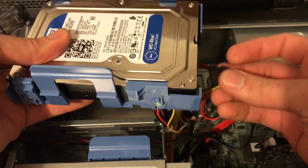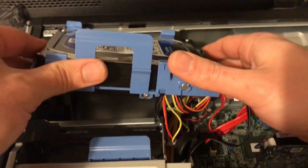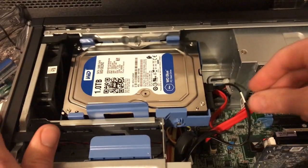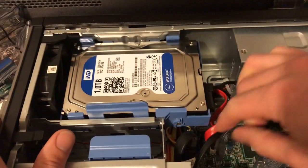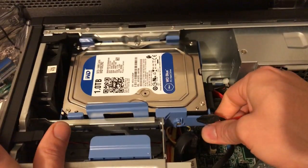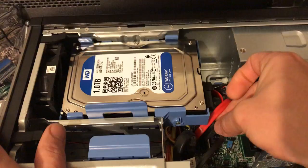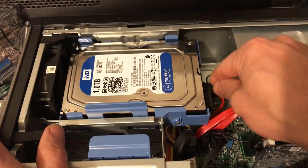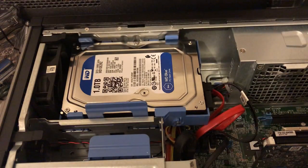So now we just plug up. Since I'm switching drives, I want to make sure I swap them around correctly. I'm going to go ahead and make drive zero my primary, which is the SSD on SATA 0, and then SATA 1 will be this new one as the second drive. The third is the CD drive. All done — pretty quick and easy install.